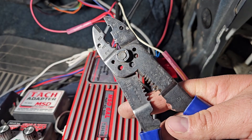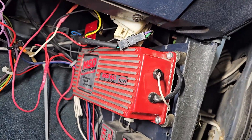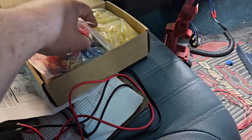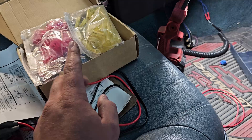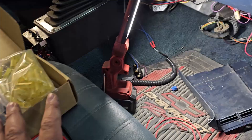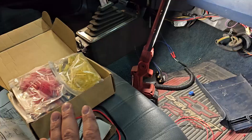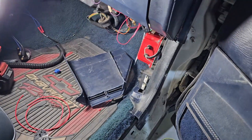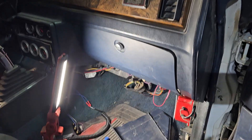When I'm crimping wires, I know I've got it tight enough when all the knuckles start to pop. Once I get the wires put back up there, it kind of tucks out of sight just like it's supposed to. The wiring kit I use came with an assortment of terminals and heat shrinks, which are very convenient. It's nice to use the colored ones where they matter — the pinkish ones are great for covering red wires, but they can be unsightly in other places, so being able to hide that stuff under the dashboard is nice. I'm going to get this buttoned back up, put the sill panel back in, put the cover back on, get the timing light hooked up, and let's go work on the timing.